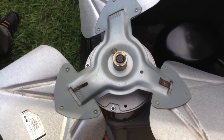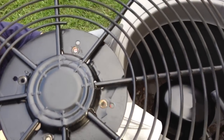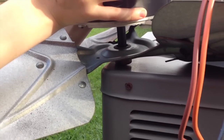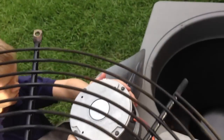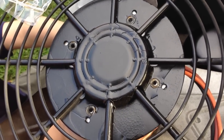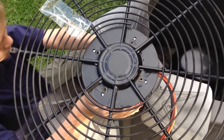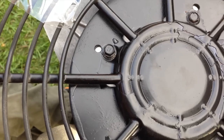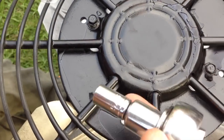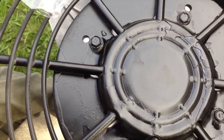Now we take the whole motor, turn it upside down, and mount it to the grill. My assistant is balancing this thing on the spindle so you can see none of the weights on the blades — we just don't want those blades to bend. We want to make sure these holes are lined up, which they are because this is the exact right motor. We're not having to tap new holes. Then I'll screw those down with the black screws. For the last one, I'm using a five-sixteenths socket on a typical cheap ratchet out of a ten-dollar Walmart toolkit — no special tools needed.